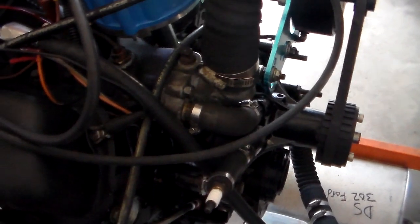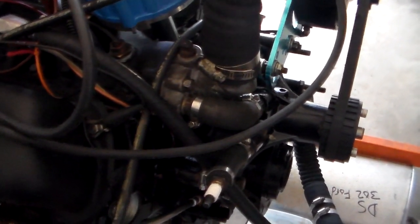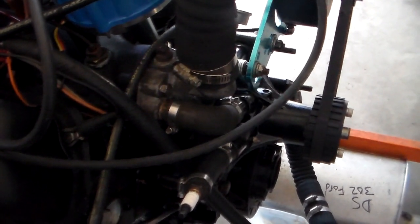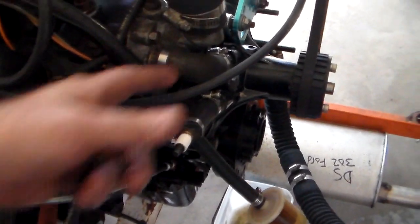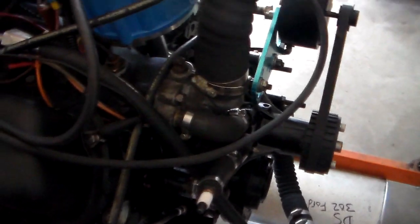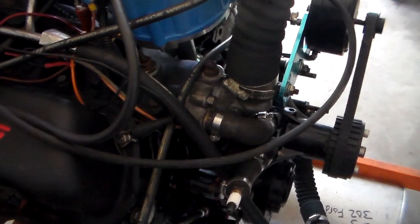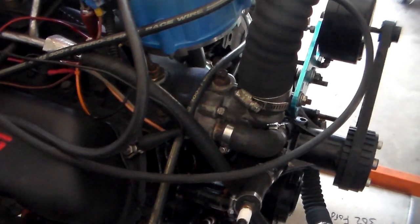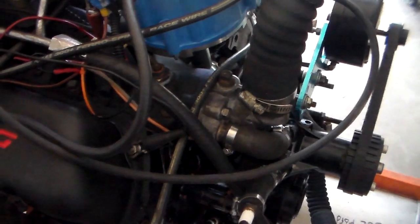Also, I didn't have my little bypass hooked up, so it wasn't moving any water before the thermostat opened. This bypass flows through it a little bit, but I just had it blocked off — deadheading right there, no seepage by it. The thermostat wouldn't open up before the engine started getting warm.